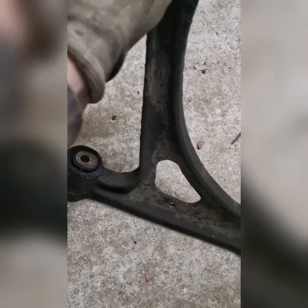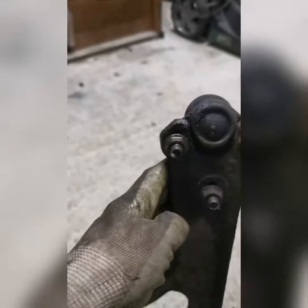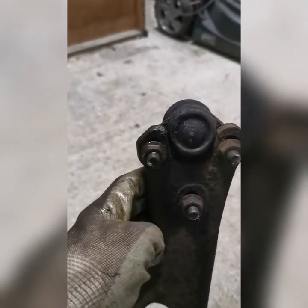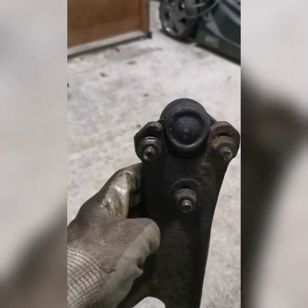Here it is — this is the offending bush. There's quite a bit of damage there, but that's going to get replaced. This one is also going to get replaced just because I'm doing this one anyway — might as well do both. This ball joint isn't too bad to be honest; I have got another one so I'll think about whether to change it. I was thinking about how to measure it and I guess the best way is to use a vernier to measure the gap on each section.